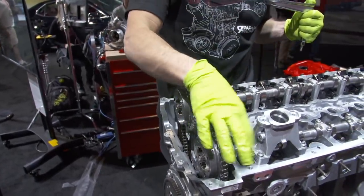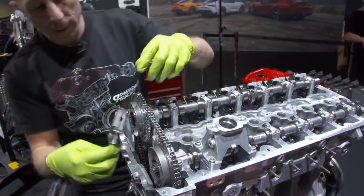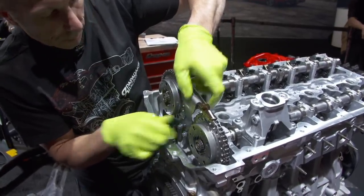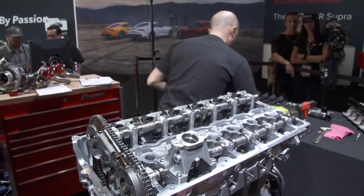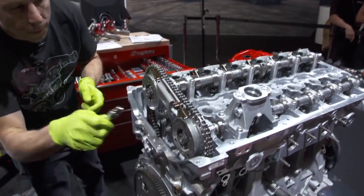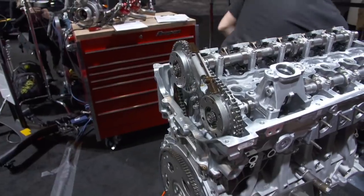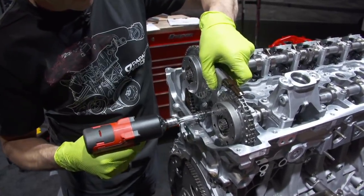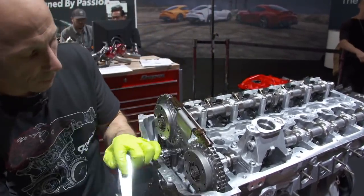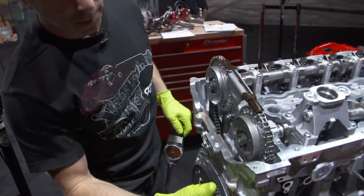Torque them both down to 7. Okay, and then I'm going to look, and I remember torquing all of these, so I'm confident with all that. This is part of the timing chain guide setup for the top here. So we'll get that on. Which I think is that size, yeah. Those get torqued on. Okay, so now all the timing guides are on and everything's aligned.